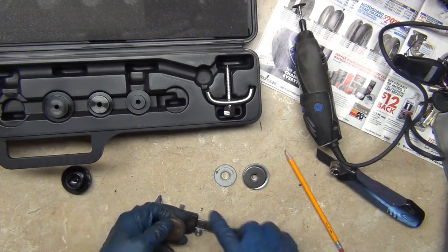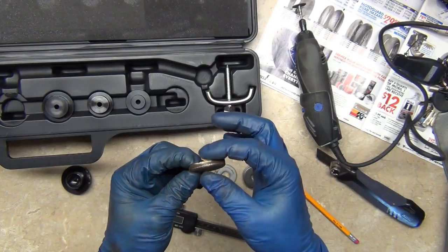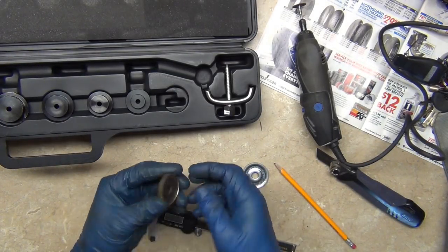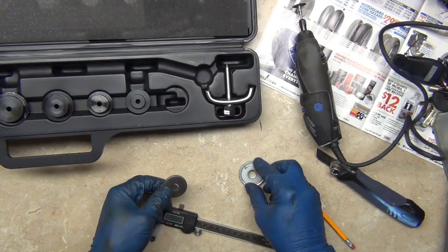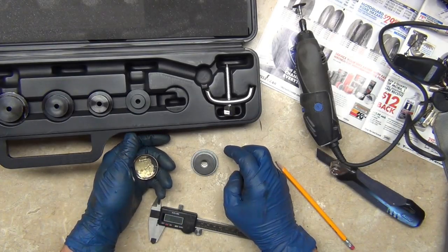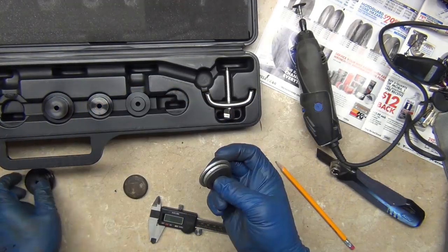You want to get the boat done, get it in the water, get the use — summer's almost over. I actually had this one holding and then I knocked it out to put in a new one, and the new ones are too big — too deep and too big, and there's no way to get them in. I don't want to grind this up. So what I'm going to do is weld — I think this one would come off better. I'm going to weld this one to this one through the center. And then once those are welded together, I'm going to stack this one on, get them exactly perfect, then weld in the inside, fill that in, and make my own driving tool that will fit in there, given that this one is just too high. Rather than destroy this one, make one that fits — that's the plan.